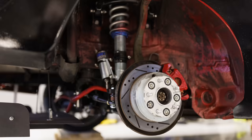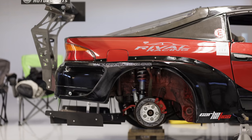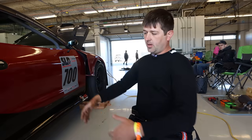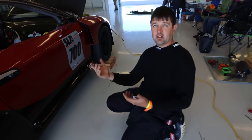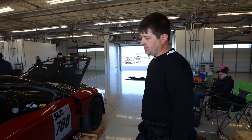And you also have pin stands. Yeah, when we have the rest of the aero kit on, it actually sits down another four inches under the bodywork. It's fiberglass almost to the center of the car so we can't get a jack underneath it with everything on. So we put pin stands in, and we have bars that extend out that we can put a jack underneath, and it holds it all in the air that way. It's a lot safer than using jack stands - safer, easier, and saves us a lot of time.